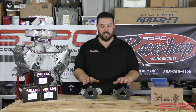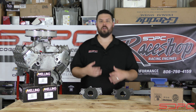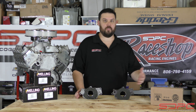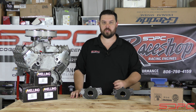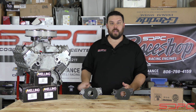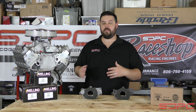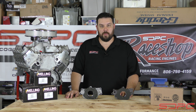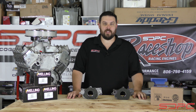If you're running a high-volume oil pump and doing sustained-RPM racing, a six-quart pan might not be enough — you'd want a baffled pan with extra capacity anyway for road racing. Give us a call for a Canton, Moroso, or similar pan. To sum it up: if you're building a turbocharged 5.3, you might just need the Melling with a little extra pressure — the 10-355 isn't necessarily required. But if you're building a road race 427 without dry sump, get a proper oil pan and a good high-volume high-pressure pump. Give us a call, visit our website, or use our chat for further questions — we'll see you next week.